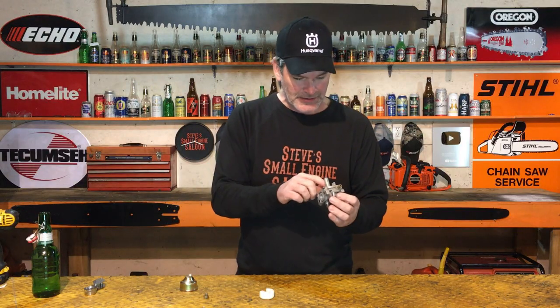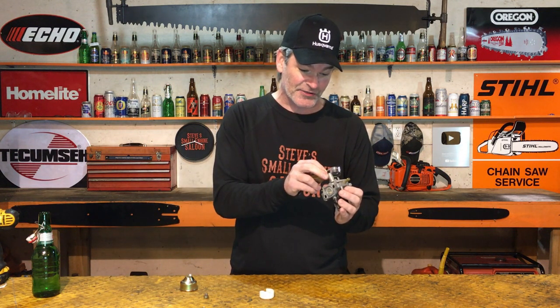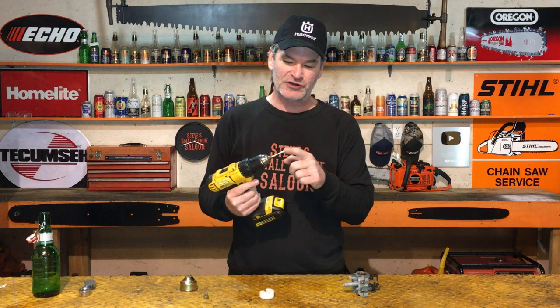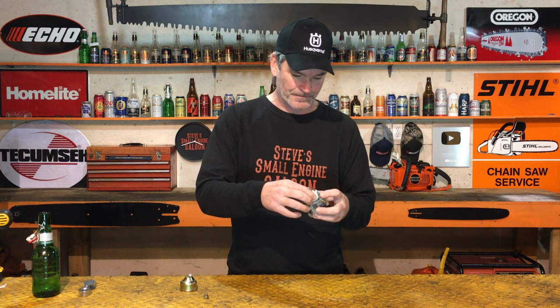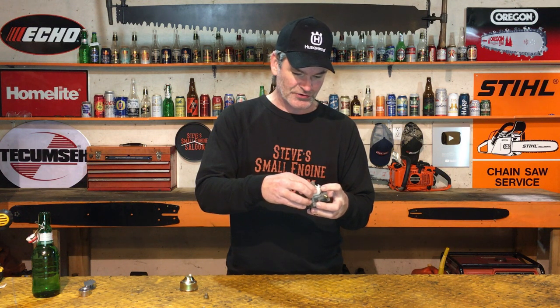Once you've done that, look down there with your magnifying glass again and you should see it's nice and clean. I've actually done this myself where you can take toothpaste — like, seriously, toothpaste — put it on the end of the Q-tip. Fine valve grinding compound will also buff the bottom of that seat out nicely. Just put it on the end of your Q-tip and buzz it out. Make sure it's nice and clean, then put it back together and get that pin back in.